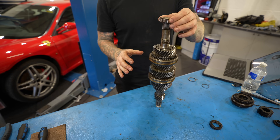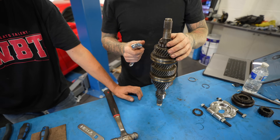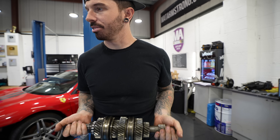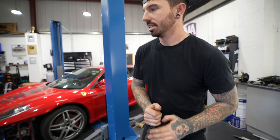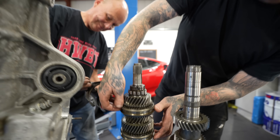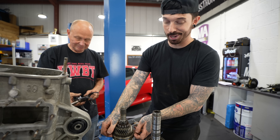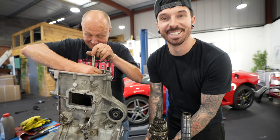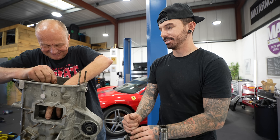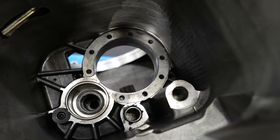The primary shaft is made up of a remarkable number of bearings, shims, and spacers — it's unreal. We think it's complete and correct, so now we're putting it inside the gearbox casing from the original car. This selector fork is how gears are selected — it slides to lock a gear into place. None of us are entirely sure how it all works, but at least we're giving it a go: if it doesn't work, we've learned something and we'll keep at it until it does.